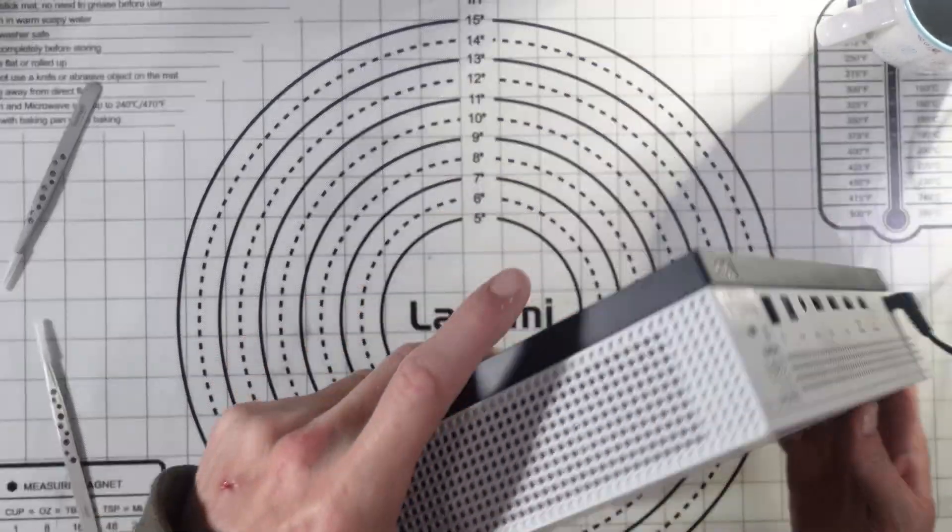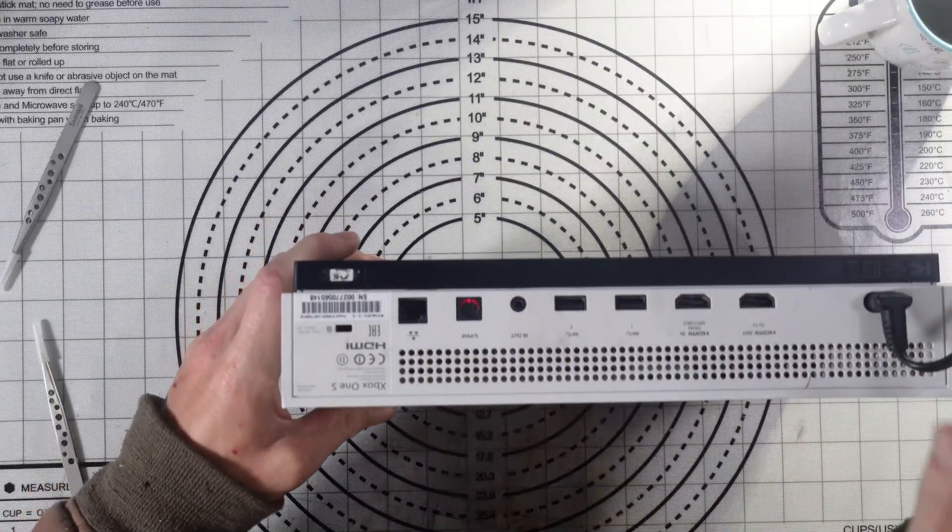I'm just going to clean the HDMI cable, make sure it's not that. I'm going to rule everything out. I'll just pop some IPA on the cable. I did do a Series X for my sister this afternoon and the HDMI was playing up, but that was my cable — it was only a disk drive repair. Still nothing. Let's plug it into my microscope just to make sure — there we go, so my capture card's working. No display. HDMI port looks fine.